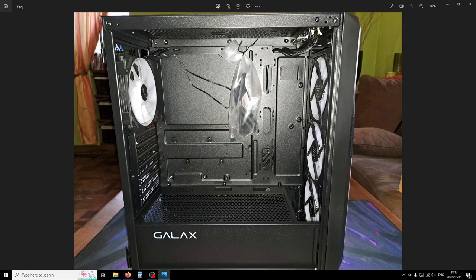To remove the PCIe covers, lift from the back to get past the first clip, then wiggle up and down — don't try pulling them all the way down or you'll bend something. If you try to pull from front to back or from the tempered glass side to the back, you'll bend the brackets. Just wiggle gently and you'll feel it come loose. The fans don't have a visible rating; they're standard 12-volt four-pin coming off the controller.